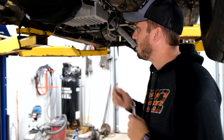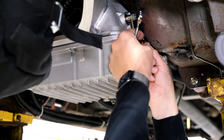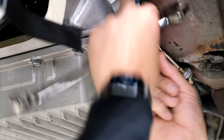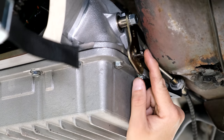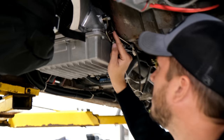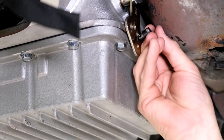I'm going to check it one more time before we're done here. I'll go all the way back to first. You can see it just kind of falls in and out right there — that is exactly what we want to see. You don't want to have to pry it in or out. Just to verify, make sure your linkage is correct and seated. Sometimes it'll pull in and out, but it'll actually be between the gear, so you want to firmly make sure it's there before you call it good. Second gear goes in and out smoothly coming from first, and neutral goes in and out smoothly as well.